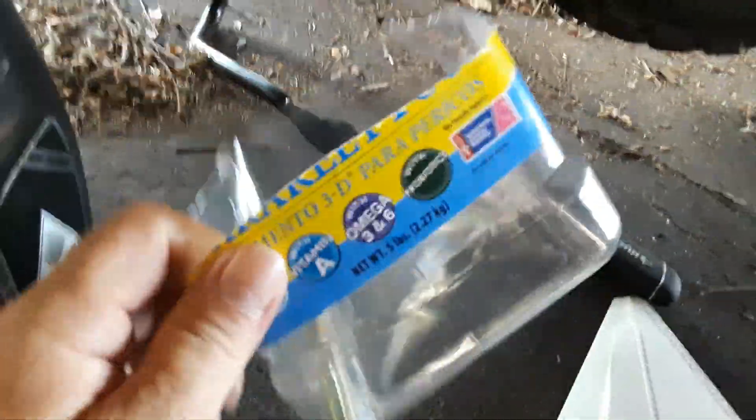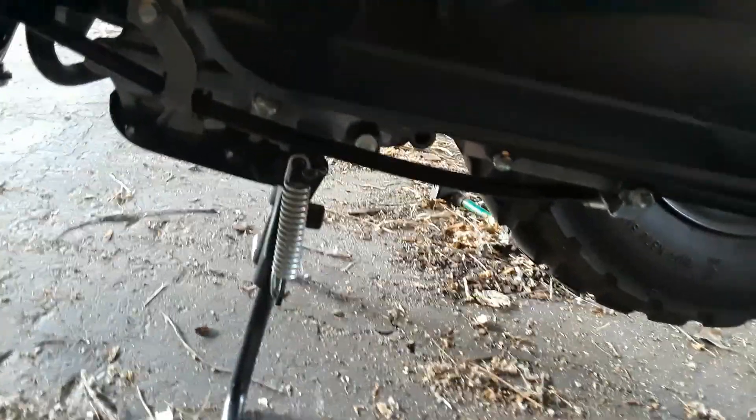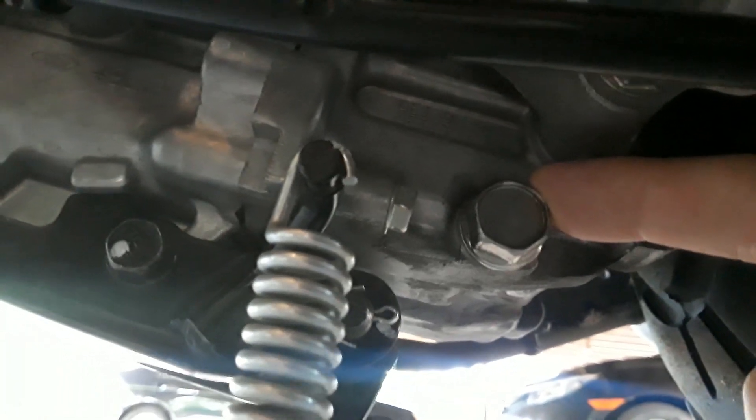We're talking about a couple of inches of clearance — half a foot of clearance — so I made my own little oil pan out of the bottom half of a bird seed container. You're looking at two bolts on the 2020 Ruckus. We're not on the exhaust side; we're on the side with the kickstarter. Right next to the kickstand is the bolt to drain the oil, and there's another bolt up front — that's the screen.